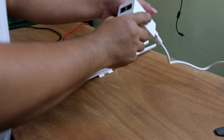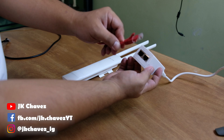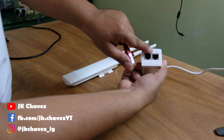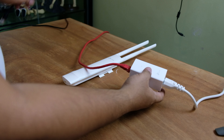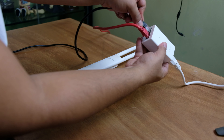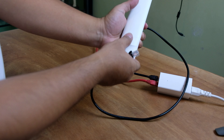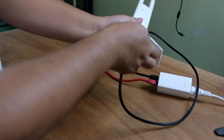First things first, plug the POE adapter on a wall outlet and get your source of internet. This will be our source of internet, directly connected to our modem router. Plug it on the LAN port — it indicates LAN. Then get another LAN cable for the POE, and from that POE it will be connected to the main access point, the EAP 110. Pull that down and plug the port on the bottom.